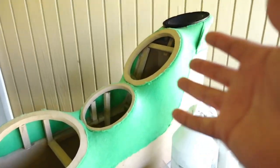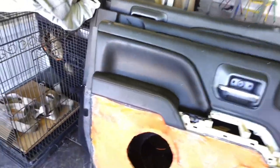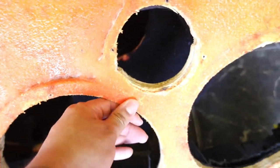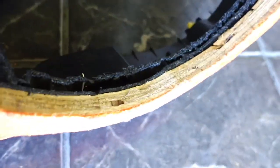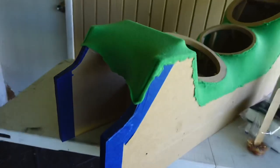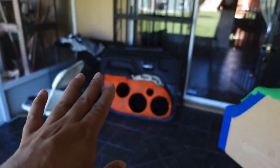Look, this is our project that we got going on. And this is another project right here that somebody else has going on that I'm gonna try to salvage and use. But look, this is what I was talking about yesterday, guys. You see the difference, how these people just lay their fleece over the ring versus we got ours stapled on here. And look at the jagged cuts. Like this right here, door panels, I'm gonna charge like $50 probably to do. Although mine's not neat like that, you can see the difference.